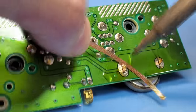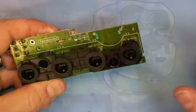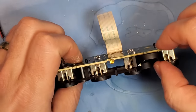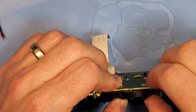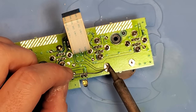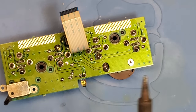While I'm in here I'm going to do some preventative maintenance — removing this CR2032 battery and replacing it with a removable one. I just desolder the CR2032 with a little bit of solder braid, some flux, and my soldering iron, and install a new one that can be easily swapped in and out.